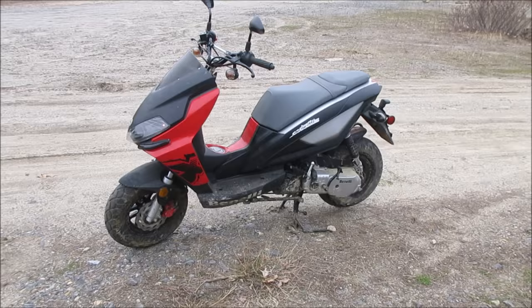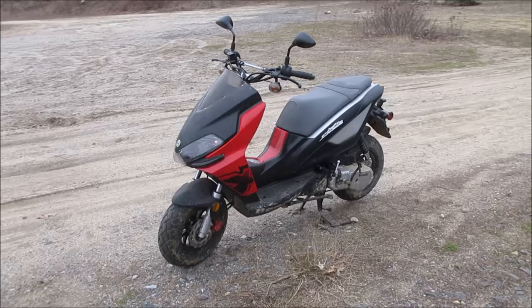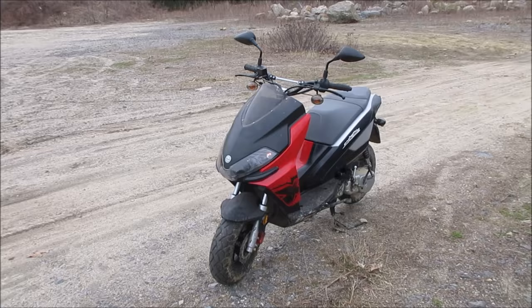All right, guys. Well, it still has a little bit of an issue. Again, it is not getting the full rev out of it, but it does get to the point where you can ride it. So I'm going to call this one a mostly successful video. How's that? I'm going to order a battery for it. I'm going to order a new CDI. I do believe that's what got taken out. I think it was wired backwards, and it probably did a little bit of electrical damage to the CDI, not allowing it to rev.